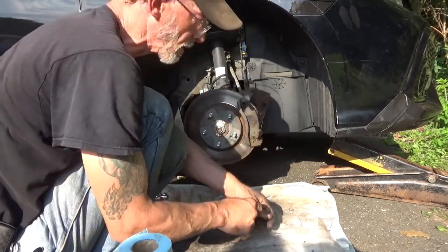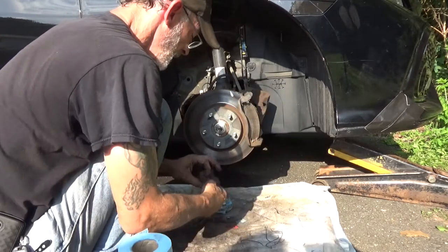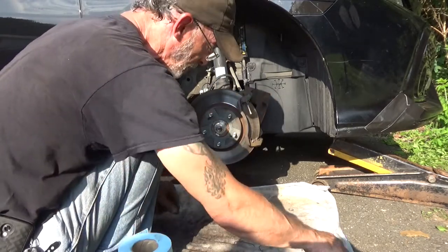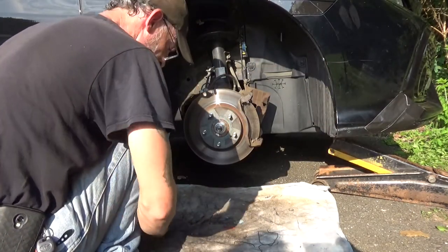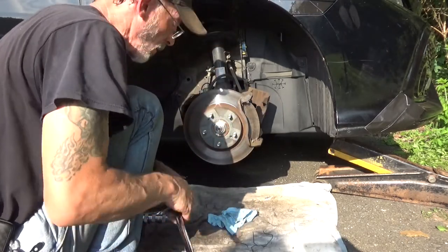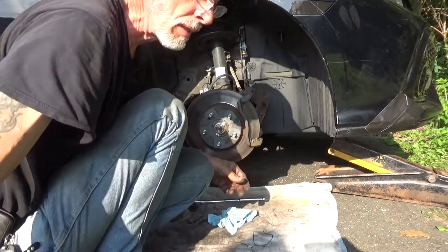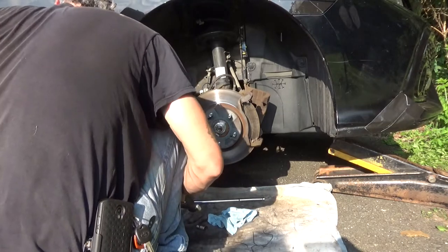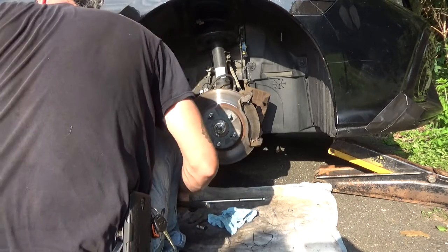Now, there are these little metal clips in here — just push the brake pads back out. They're not too bad. These are actually not really in need of it, but the customer said he's got a little pulsating, so that tells me his rotors are warped — the steering wheel shakes a little. So we're going to do pads and rotors. We did the back brakes first because they were most likely going to be the hardest — they needed the use of the scan tool. These right here are just regular basic disc brakes, no special bells and whistles. Even the rotor doesn't have to be fought with, so all nice and easy.